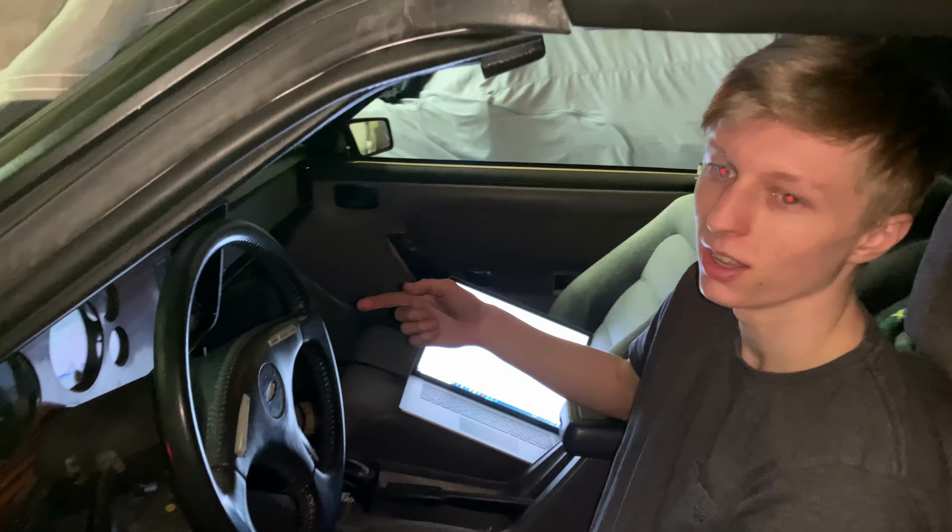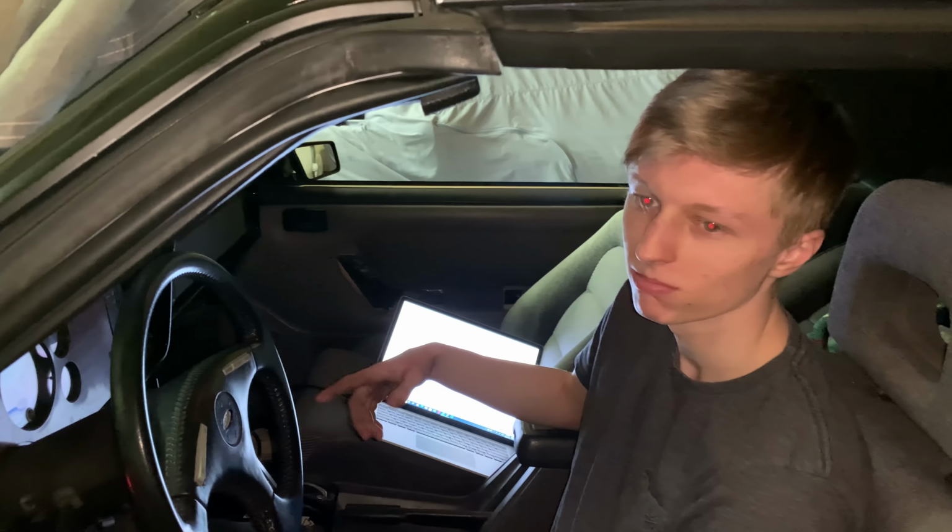So at the end there, I don't know, did you get it on camera? I'm not sure, but it started. But the engine hit like 70 or whatever Fahrenheit, and it kicked on the closed loop. So the short-term fuel trims started pulling out a ton of fuel. And then the RPM started going up and it started popping a bit. So it ran good before then.